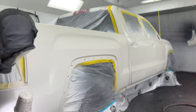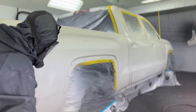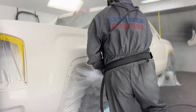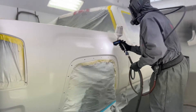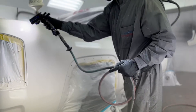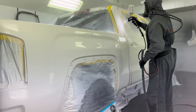The ultimate thing that I do with my sealer to make sure that I get the best coverage — because we know that whites are thin and transparent — is I mix up my white sealer with 2% black sealer. Give it a very, very light gray. It'll cover a lot better than just straight white out of the can. And I under-reduce my white sealer anywhere from 5% to 10%, making it a little bit thicker so it covers better.